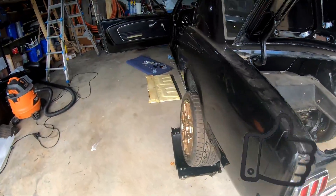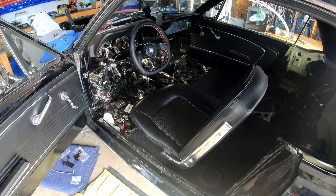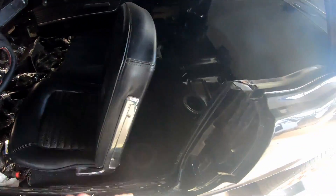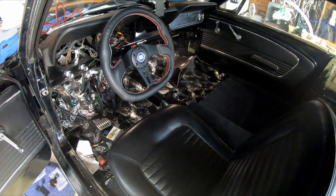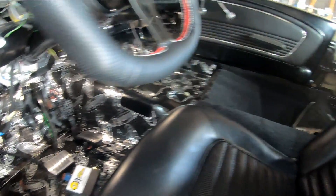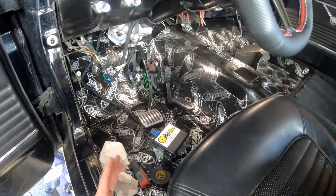On the inside here, I've been doing a ton of stuff. I sanded everything all down to the metal and got all of the rust out. I used the POR-15 metal cleaner and then the POR-15 metal prep, but I used Rust Bullet paint on all of this and it came out great. The only reason I used Rust Bullet was because it was highly recommended and it was maybe half the price. Then I put Dynamat all the way around. All of this was just a kit from CJ Pony Parts — it was awesome and worked out really well.